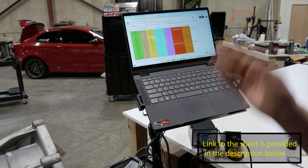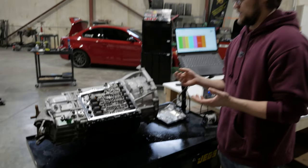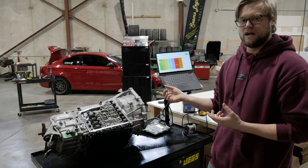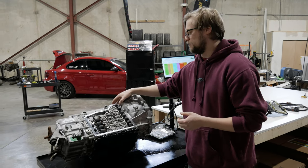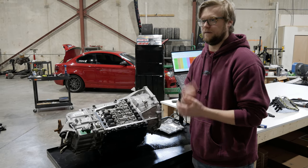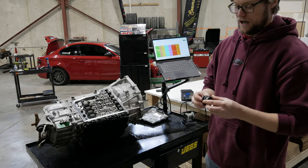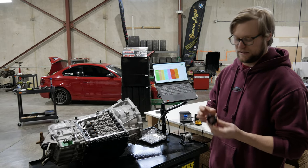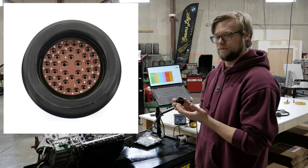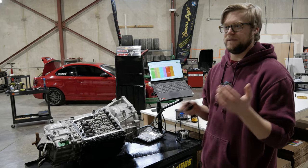This is the easiest page to use as a reference as you pin out the connector. There are really only three wires you need to solder, because we think that taking the front cover off and the clutch off to get to the front three sensor wires is kind of a hassle. That's why we marked those three wires before we took them out. So the first step is definitely grab your connector. If it's not assembled, just assemble it with a little red Loctite. Then take a second and get familiar with how the letters are laid out before you go and start putting pins in. It's much easier to take your time and put the pins in once than to be taking them in and out.